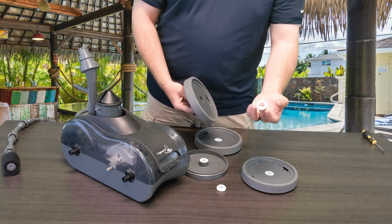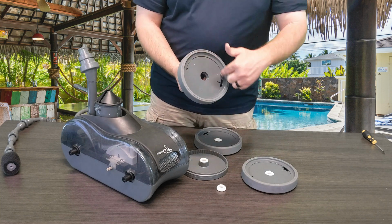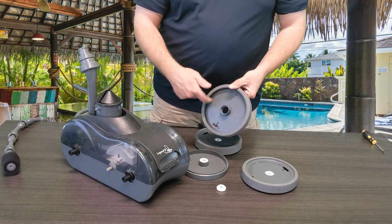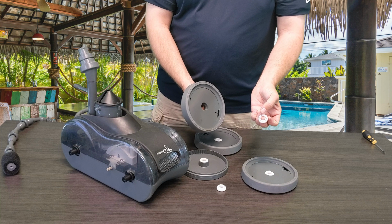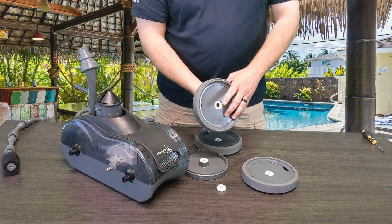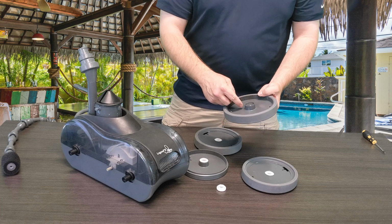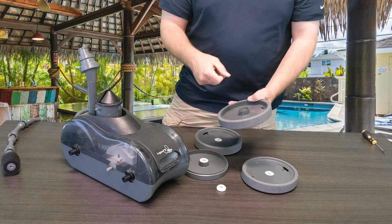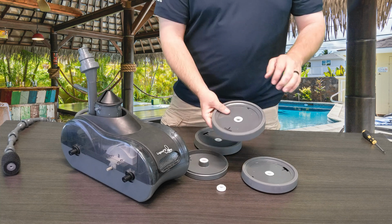To reinstall, you're simply going to take your new ones, and from the outside of the wheel, as you can see, this is where the hubcap would actually go, and this is the inside. Obviously, this is where the axle shaft is going to run along this. So you're going to look at the outside of the wheel. You're going to face these notched edges with the ball bearings exposed inward onto the wheel, and all you simply do is push them in until they are as flush as you can get. Everything's even. The wheels are actually milled so that you can't push the bearing in any farther from the outside or the inside, so you don't have to worry about over pushing or trying to block it from the inside. You just merely push it in.